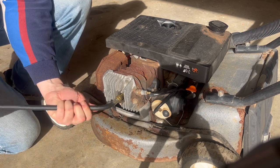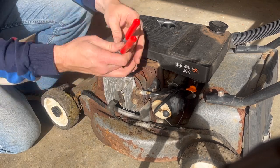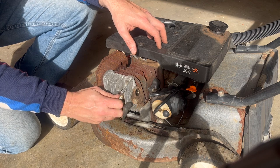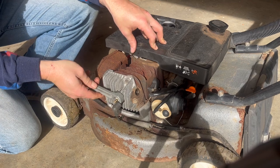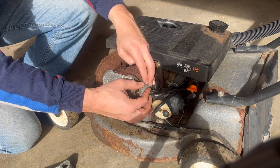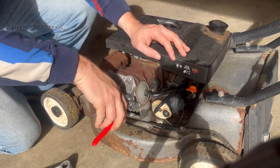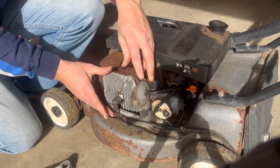When you finish testing the compression, simply take your compression tester out, take that spark plug out which we temporarily put in the decompressor hole, and pop it all back together the way it was. Spark plug back in, pop that boot on, put our decompressor back in the hole — do it up snug, no need to over-tighten things. Pop that vacuum line back on.